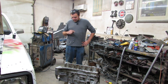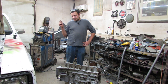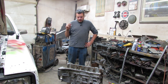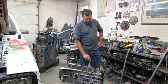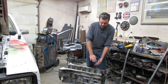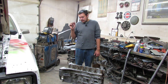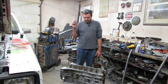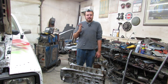Let's talk about the oil pan. Something that a lot of people struggle with is they cannot get an oil pan that fits their car with this engine. The factory oil pan for the six cylinder is a front sump oil pan and it's very deep. There is a company where you can buy a rear sump oil pan, but they are expensive — in the neighborhood of $700 to $900.